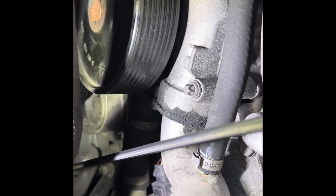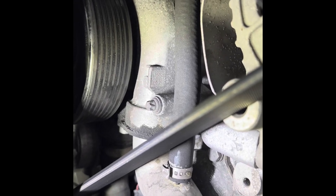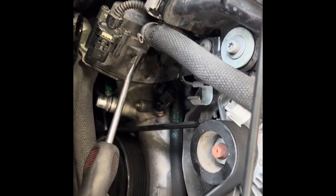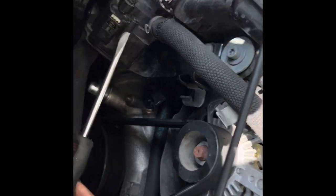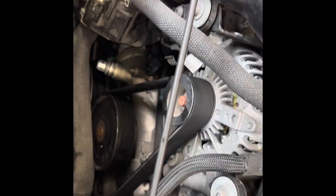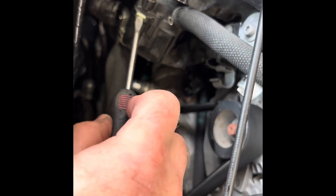There's a little piece left that's actually leaking — seeping — on my car, and I'll probably replace the rubber hose while I'm at it. In these tight spaces there's no room to unclip the top sensor, so what I'm going to do is remove this electric water pump. It should be fairly easy — a couple of Torx screws, probably T27s, and a connector. I'm going to put it all the way on top and out of the way so it gives me room to work.